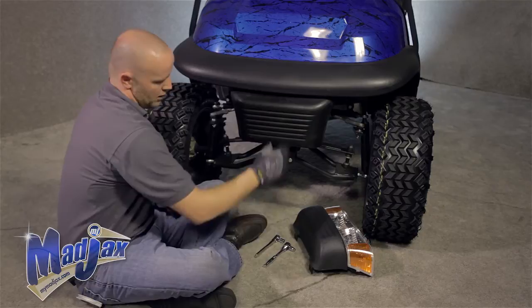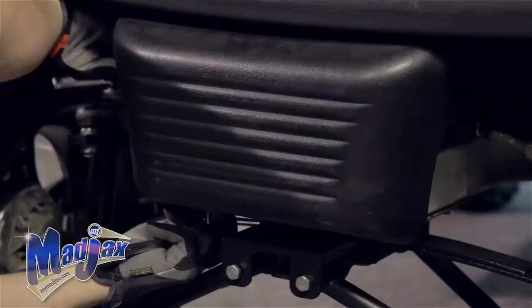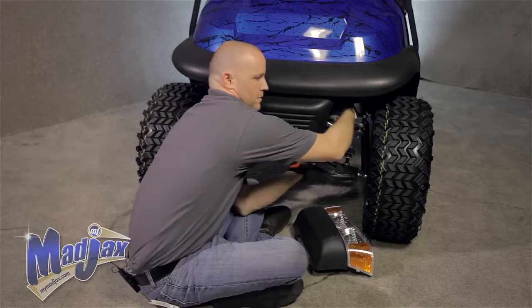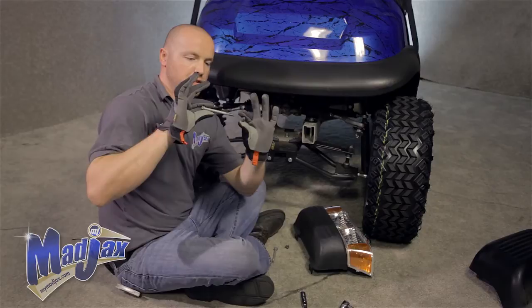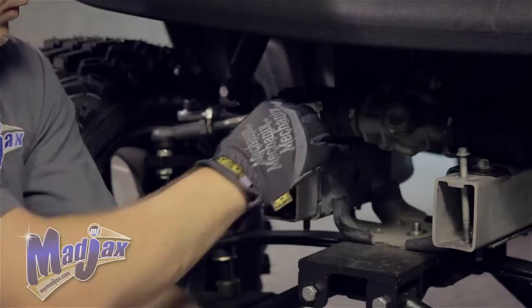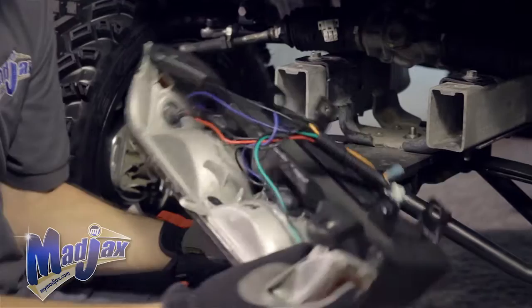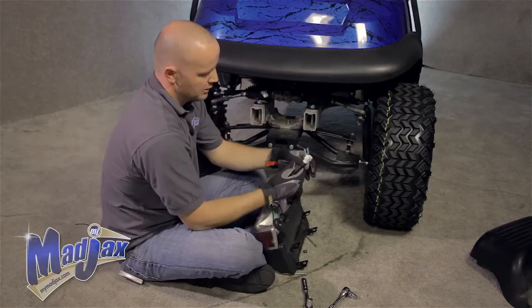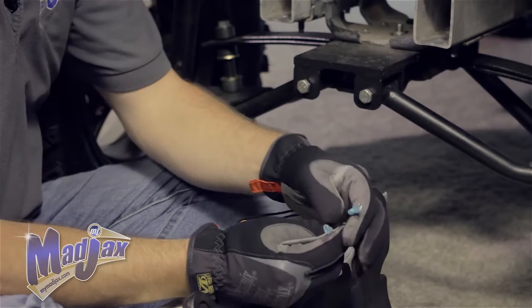Now that we've reattached our dash, we're going to remove our front bumper. There are two bolts located behind the bumper; we're going to use our 10mm and 13mm socket and retain those bolts. Remove our front bumper — we're not going to need that anymore. We're going to use these bolts to attach our front headlight bumper here and here using that factory hardware. Also, using the six pin connector that we ran through our front dash, we're going to attach our headlight. These extra two wires are for the ultimate light kit upgrade horn.